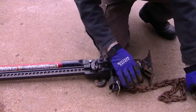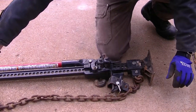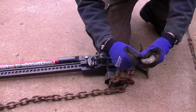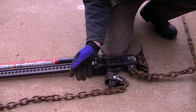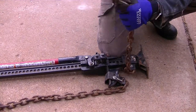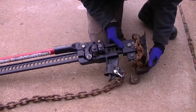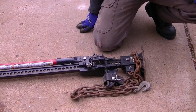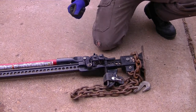This part actually goes on the foot and hooks to a 3/8-inch link chain, so as you pull, the chain pulls. When you get to the top of your jack, that's where this secondary chain comes in handy — it links under the chain you're pulling so when you let off pressure to re-hook further down, your chain doesn't go too far. It'll make more sense when you watch the rest of the video. It's actually pretty simple. There's a lot of work but it does a good job — I've used it many times to get myself out of binds out in the woods.